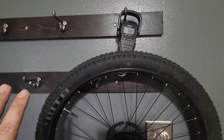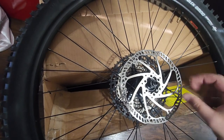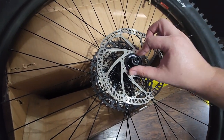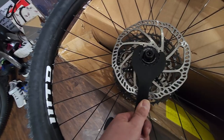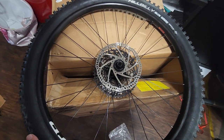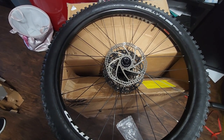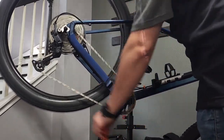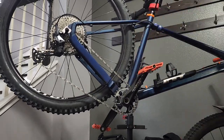This is the center lock to six-bolt rotor adapter. Put in the cap, grab the bottom bracket tool, and torque to 40 Nm — click. Now I can put this on the bike. I already set up the gears, so it should be good to go. Who would have thought that all I needed was a compatible cassette? Now it's shifting perfectly.